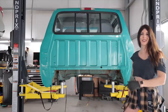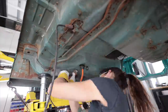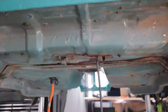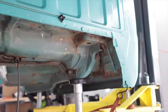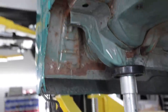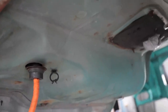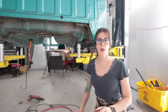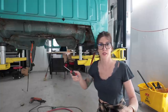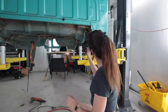So now it's time to go under here and sand. The mini DA ended up being the tool of choice for this task. I think I got pretty much every area underneath here hit up with the DA with 80 grit, and then all the big smooth surfaces I did with a red scotch brite. I'm not really worried about any of the rust here getting any worse because the truck's in Arizona now, not New England — so way less of a threat.